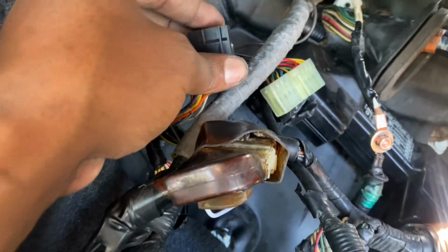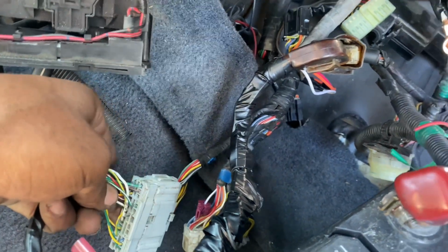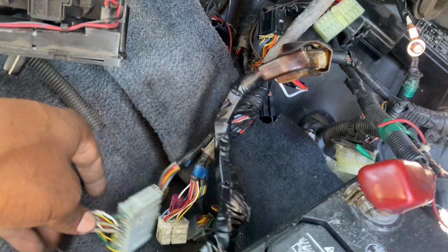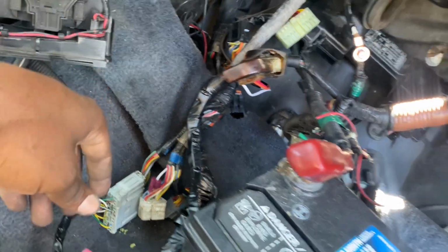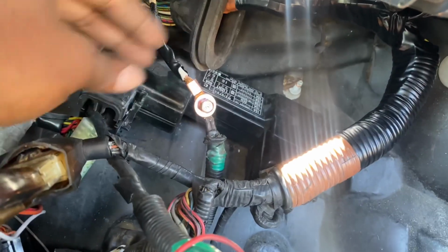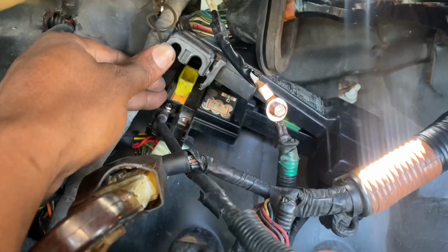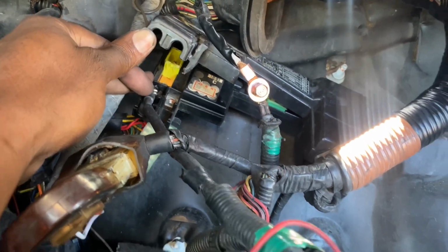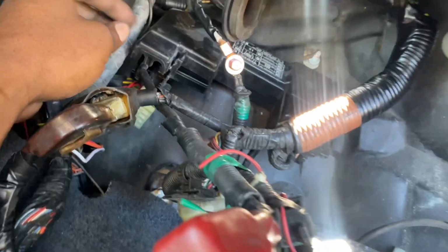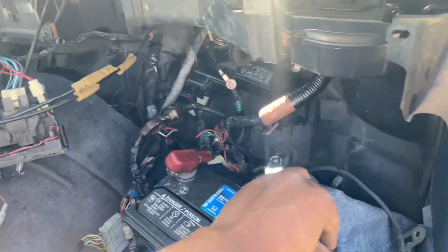Those are the 3 wires you'll be taking off to connect, like I said, to the fan relay on here, which I hope works. I haven't actually tested it out, but that should be right. I know the electronic load detector and the check engine light is right. Other than that, I've also connected the starter wire to the starter. So, and I connected the fuse box to the battery. So hopefully right now, when I plug in the ground, we can get a starter signal.